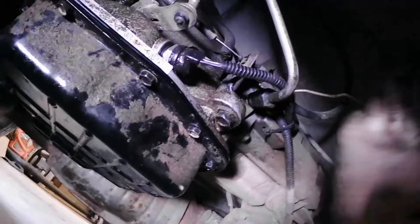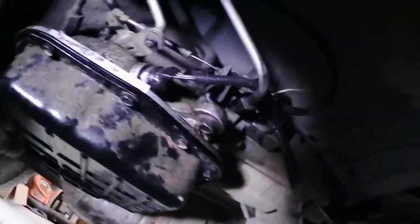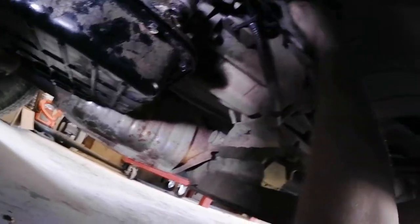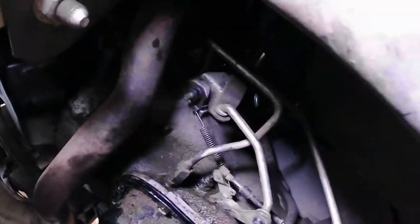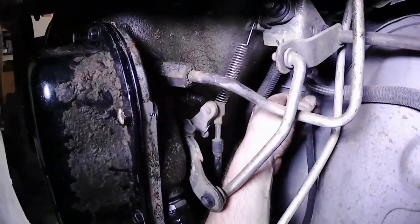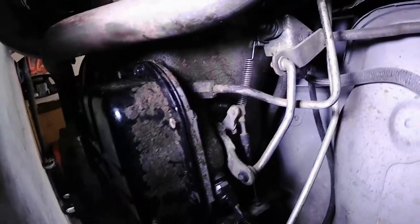Don't lose that spring — you have to have it because that's your rebound for it. It is a two-hand job though. Once I get this clip or spring undone, get it unclipped and get this off, it should be fairly free. Looks like someone put a zip tie on that — or maybe it's a clamp. It looks like it's clipped on to the fuel line to hold it in place, then it just goes up to the engine bay where it unclips. Mine has unclipped itself by breaking — that's why I'm replacing this one.